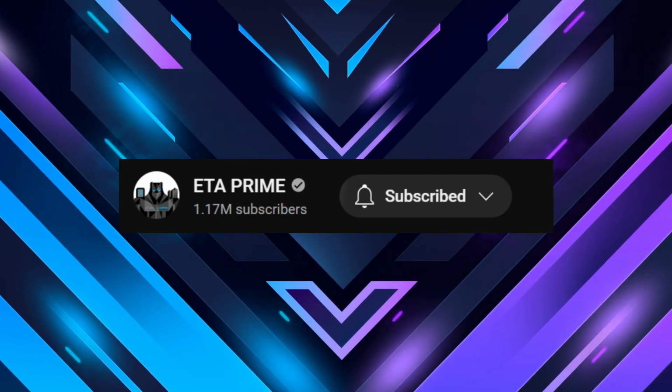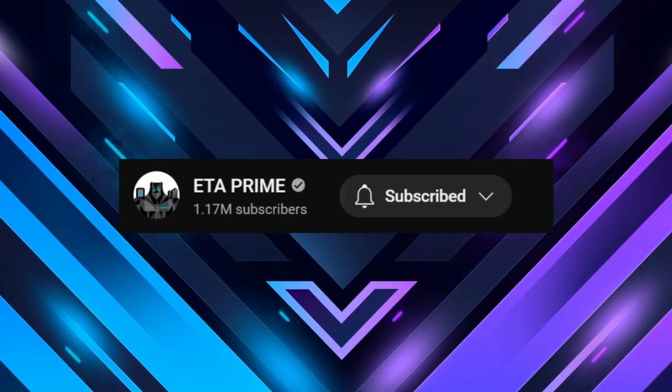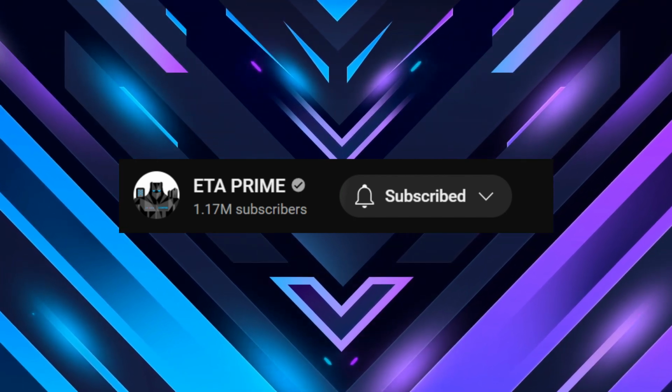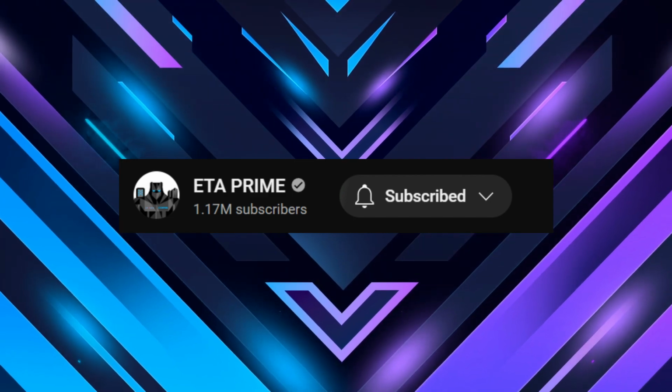Now, before I go any further, I want to say that while I was researching whether or not I wanted to buy this laptop, I came across a video by a really great YouTuber by the name of ETA Prime, and he highlighted how with this specific model of laptop, right out of the box, it's only set with a TDP of 15 watts. But what you can do is go into the BIOS and adjust that manually up to 30 watts, and you can get significantly better performance if you do that.